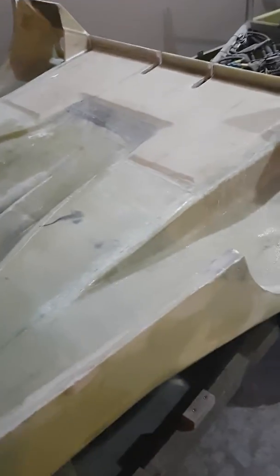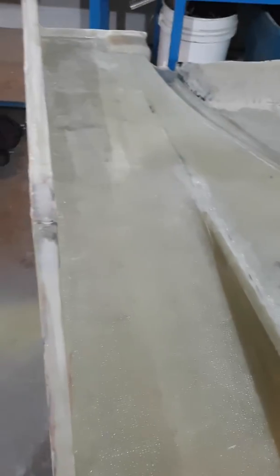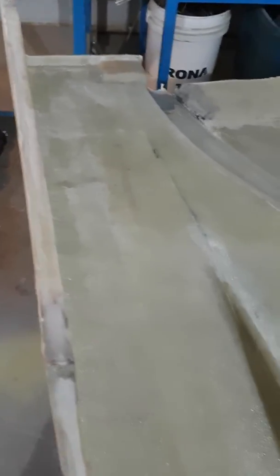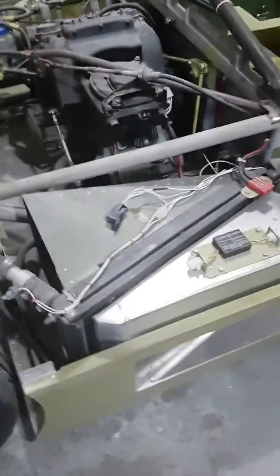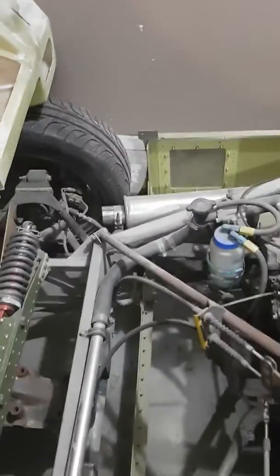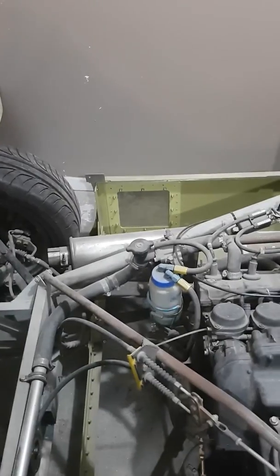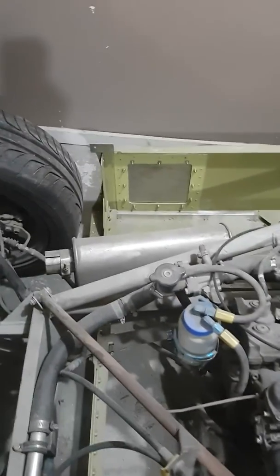and everything moves. I've got to add in another partition just ahead of the rear wheels there that ties in the side to the top, and obviously that's nice and thin, but it's also not quite rigid, and there's nothing reinforcing it. I could add in some foam right here, or I could add in the partition, which I'm going to need anyway, to protect the radiator and the exhaust components from debris thrown up by the tires and wheels at the back there.